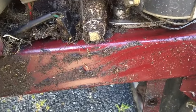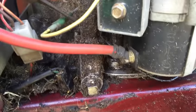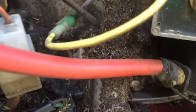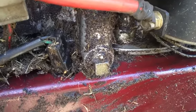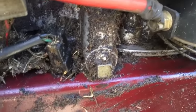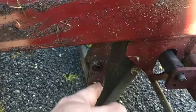My next job today is not electronics-based but mechanical. That's the filler tube. I'm hoping it's just a worn O-ring at the bottom of the filler tube, or it could be that plug there is a bit loose and oil is running down inside the engine through the base plate and onto the belt. All of this is soaking in oil down here.